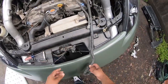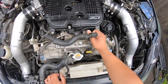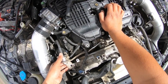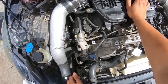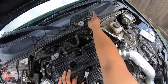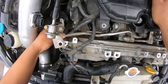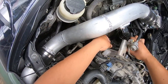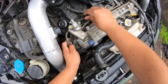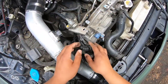Now that we have this unattached and all disconnected, we can start. You're going to have to remove this one just because it makes the job a lot easier — this is where we're going to route all our stuff to. You can just take off the PCV hose. Lift this up carefully because this is your fuel line — don't lift it up too high, just enough to get wires underneath it. This other line that we disconnected, I'm pretty sure it's for the alternator. We can just literally snake that in through right underneath that one tab it was being held on by. You just need to MacGyver it in there — you can literally snake all this wiring through here. Put it right through here so it's underneath that hose, and route it whichever way you want.